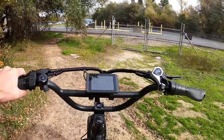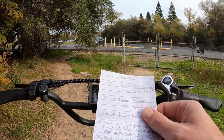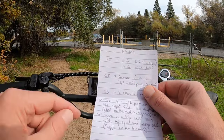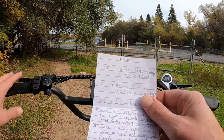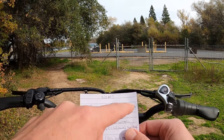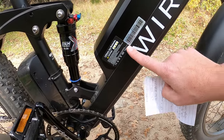I'm going to pull out my notes. First thing: the P5 setting — you want to set it to six, not to 16. In my menu options video I said put it to 16, but that is if you have a 2023 model with LG cells. When I spoke to Wired, I didn't mention exactly what model I had and they assumed I had the older version. If you have the new 2024 Wired Freedom, put P5 to six. If you set it to 16 it'll be okay, but your voltage meter on the bike will be inaccurate. You can also check by looking on the side of the battery — the 2024 has Samsung cells, not LG.